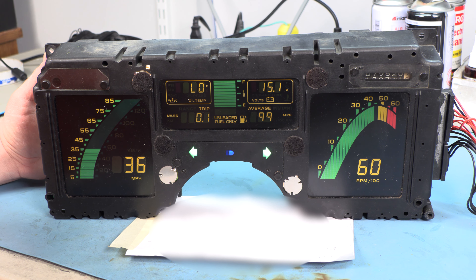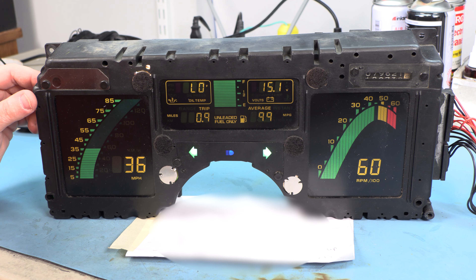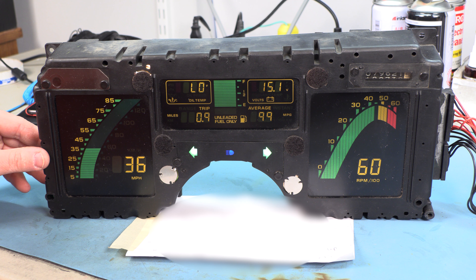He also says that his left turn signal isn't lighting up, so we're going to check for intermittent operation of this left turn signal bulb. Daniel also mentions that the cluster went dark a while ago and now it's working, which tells me we've got some intermittent operation that we need to identify.